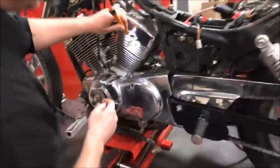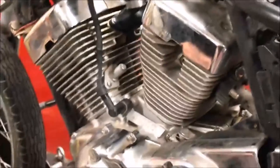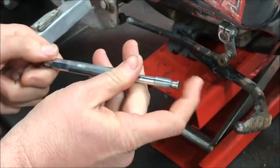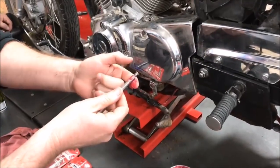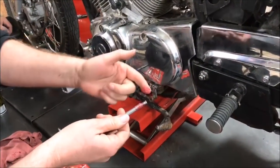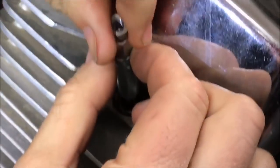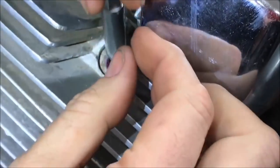What we want to do right now is put it in gear and move that piston down so we have plenty of room for the tool to get in there. I'm going to loosen my tool — I want to get this as thin as I can so that it can collapse or compress. I'm going to grease this up pretty good so all those filings stick to it and I can pull them through. I have to be really careful to pop past that last thread.